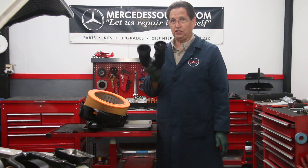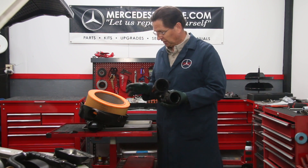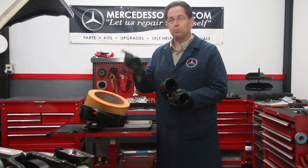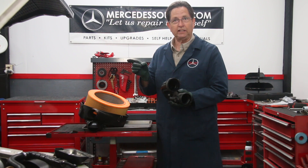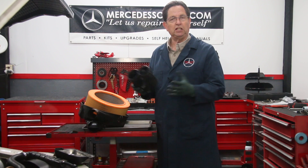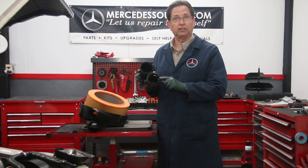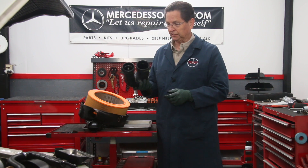If you've got one of these and you've never taken this off and looked at it, you need to inspect these seals. You need to take a close look at all the breather fittings — from the valve cover into the air filter housing — they need to be tight and soft. If not, you need to fix this. Don't drive the car until this is fixed.